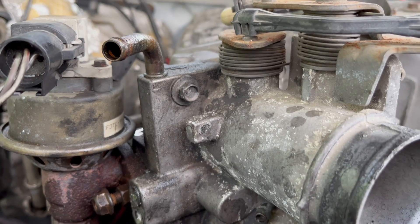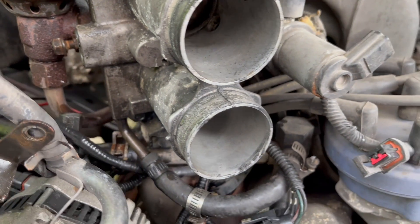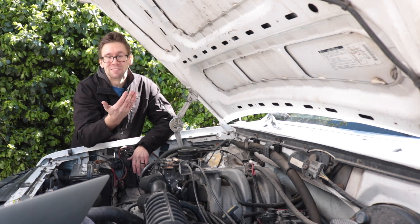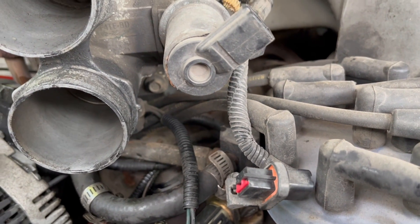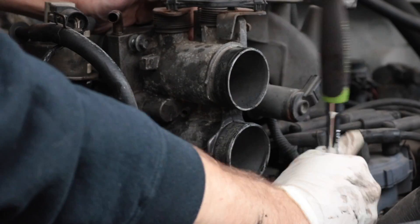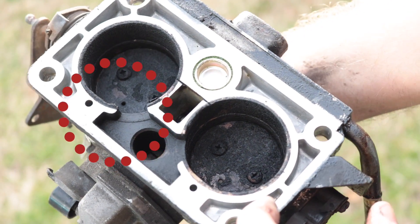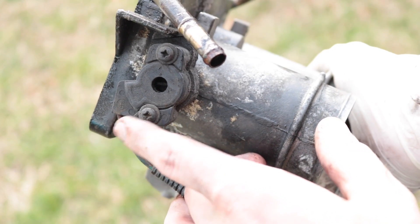Now that all that fun stuff is removed and disconnected, it's finally time to remove the throttle body and get that throttle position sensor — the whole reason we're in here. You've got one bolt on the upper front top, another bolt in the lower front, and then you've got to go a little deeper in the behind — I call this area the gruntle. There are four bolts total, three-eighths, for whatever-was-laying-around-that-day reasons. Pop that big boy off. If you look closely at the throttle blade upper left, you can see the idle air hole is completely blocked off.